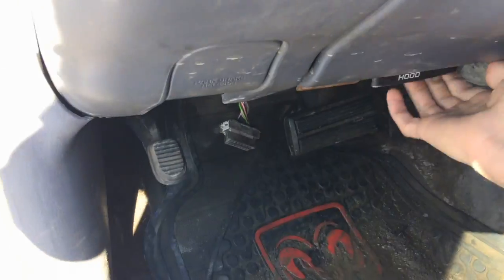Okay, engine starts good, exhaust is a little loud. That could be a very simple fix. It could be a crossover pipe, or it could be the manifold. If you find a cracked exhaust manifold, you're going to want to keep the old one off your blown engine. You're going to want to definitely keep some parts here. Next, pop the hood.